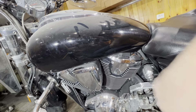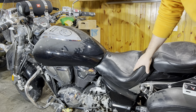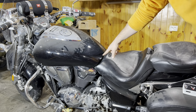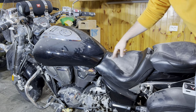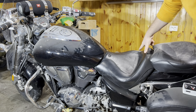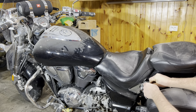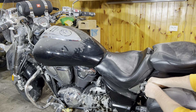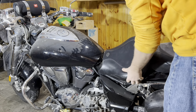We are now under the motorcycle. You can clearly see a drop of coolant here, and another drop over here as well. This area is wet, but it's not leaking from the hose — the problem lies a little bit further up. I need to remove the fairings to get access to the radiator itself.